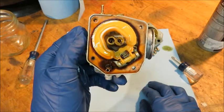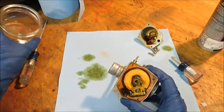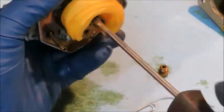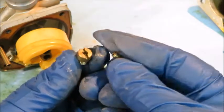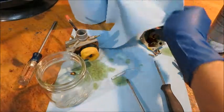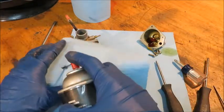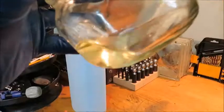Now in here is what we want to take apart. We want to remove this middle piece — that's the jet. That's what's going to be all clogged up, and we're going to soak it with some carburetor cleaner in this mason jar. These two items are what's responsible for delivering fuel to your engine, and this is what's going to be all clogged up. So we're going to drop these right in there. I'm going to spray the carburetor cleaner in, keeping it up against the side so it's not making an aerosol — just filling the container. There we go, it's in there getting soaked.